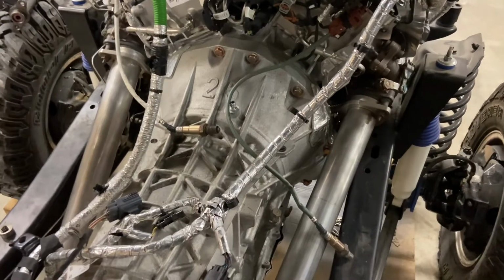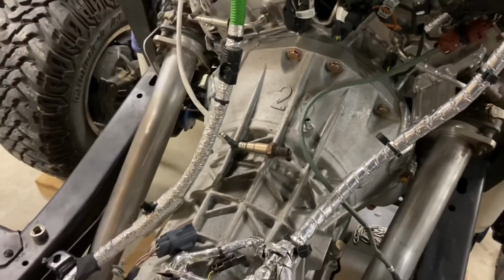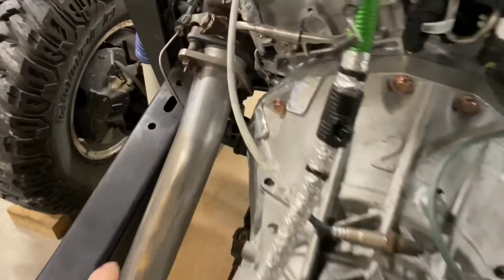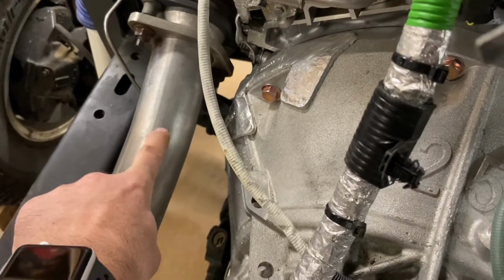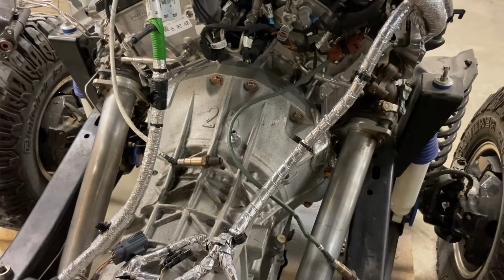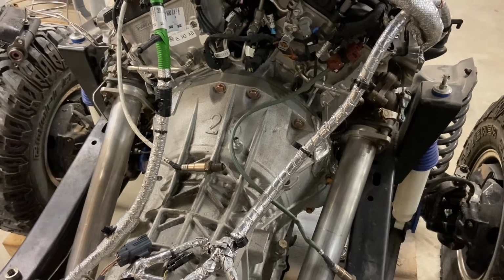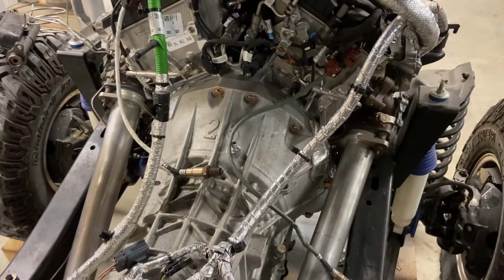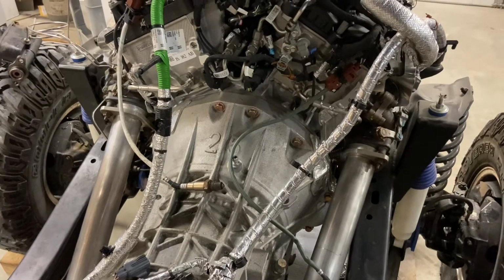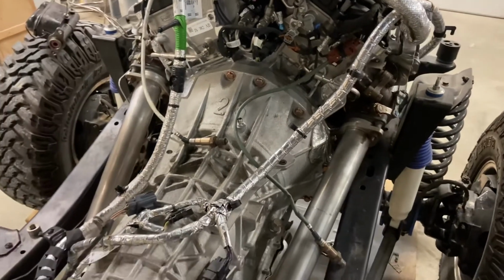And although this tube's somewhat straight based on our kit on both sides, this side we're straight for about 5 or 6 inches. We just want to replicate as close to stock as possible, because some of the misfire monitors and other things in the calibration we want to retain because that's helpful for diagnostics and such on the engine in the future. And so the placement of those bosses is kind of important.